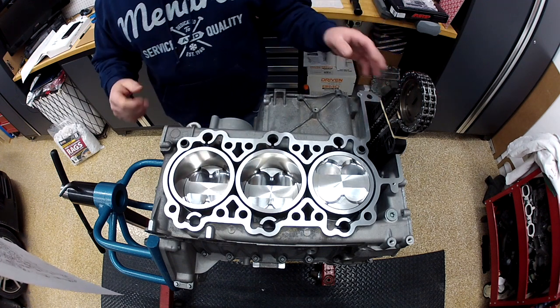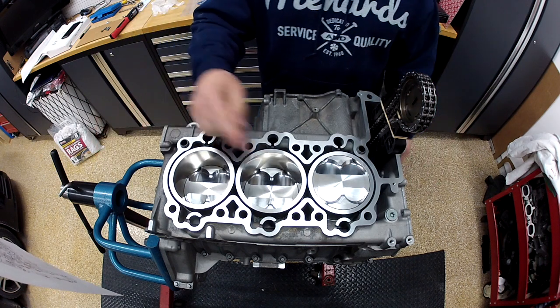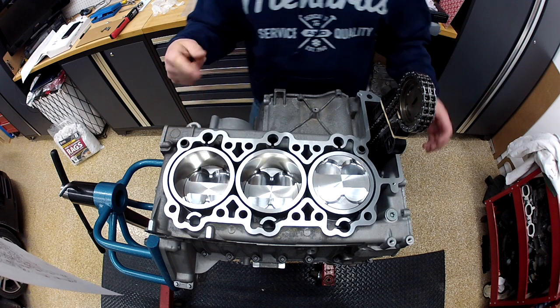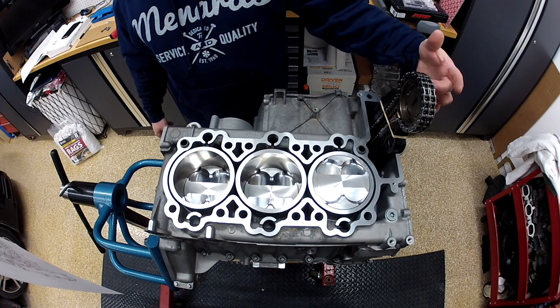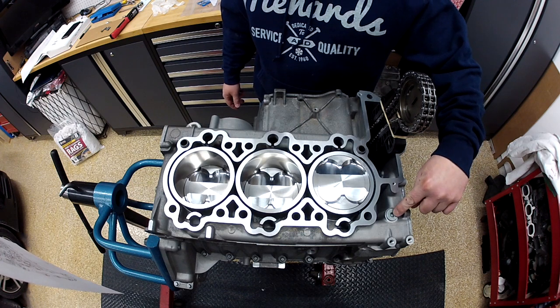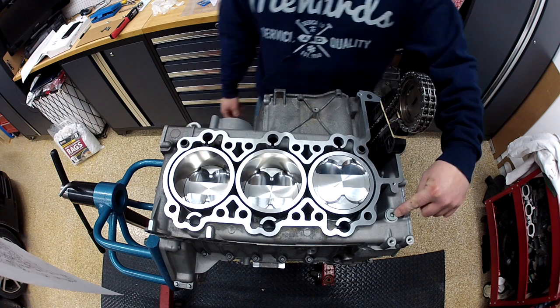This is bank right side, which means it's cylinders four, five, and six. We have the chain guides rubber-banded together along with the cog here, and it's very important that we don't forget this bolt here when mating this case half onto the crank carrier.